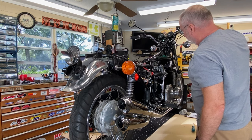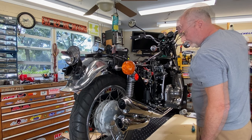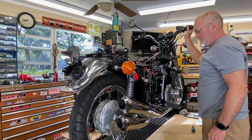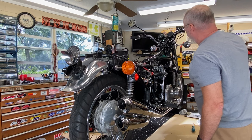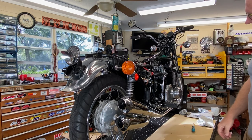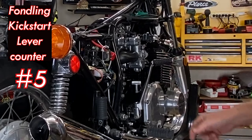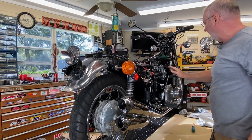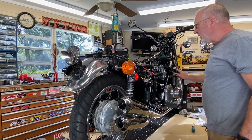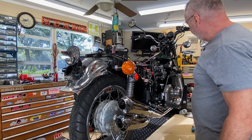She's got to warm up. I don't know if I like that — I think I might change those over to 122.5. I kind of liked it better with 125s, but that was with the other exhaust. There's a little pop when you just start to crack the throttle, which should absolutely not be the case because the timing is spot-on and we've got good spark. That still seems a little lean to me.